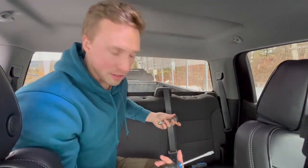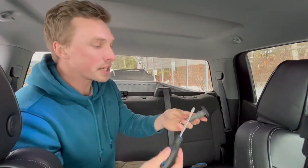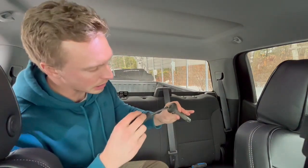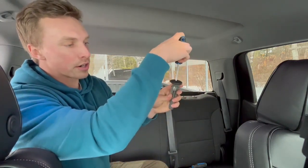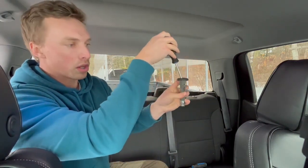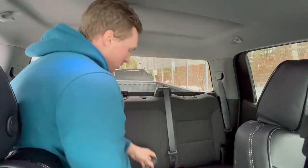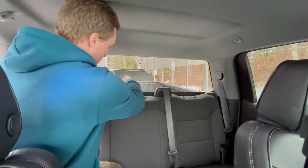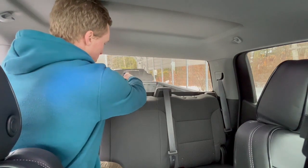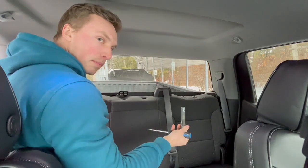After some contemplating I did decide to take the back seat off. To get the back seat out you need to take out the headrests. There is a little clip in here and you can slide your flathead screwdriver in here — all you do is pull it a little bit while pulling up with a pry tool, find where the clip is, pull it a little bit, and it just pops right up just like that.